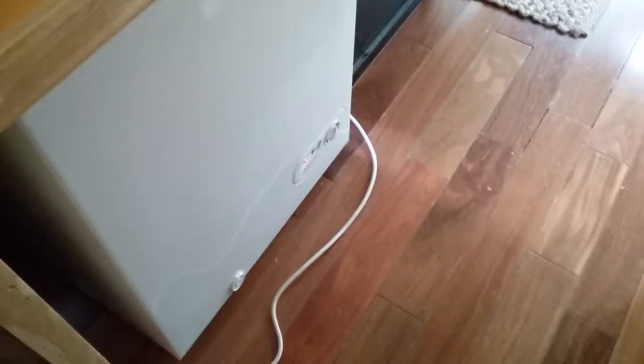You can get a big refrigerator, but they're power hogs. I wouldn't do that, but it's up to you — everybody can do what they want, to each his own. But I'm definitely happy that I did this. It barely ever runs. It just stays ice cold and pulls no energy off my inverter, no energy from my battery bank — it's just idling. As soon as that green light kicks on, it's 30 watts for like a couple of minutes every hour or two, and that's it.